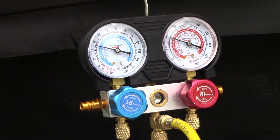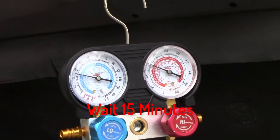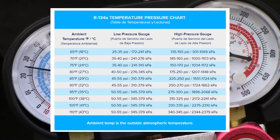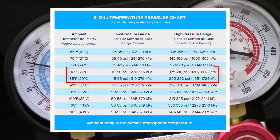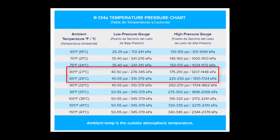Now that you have these numbers, let it sit for a little bit, and while you're doing that go online and find an AC pressure gauge chart. These numbers might go up and down a little bit but they'll probably stay about the same. You have to compare the outside temperature with the temperature on the chart. We're looking for between 40 and 55 psi on the low side and 175 to 250 psi on the high side. From the numbers we got, we can see that we have low refrigerant in our system.